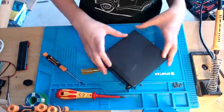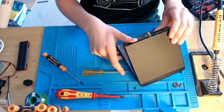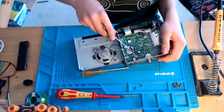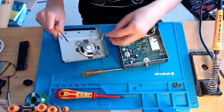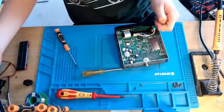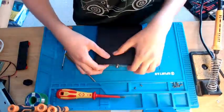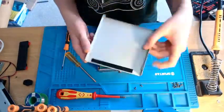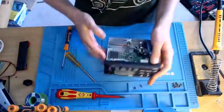The next thing you're going to do — now you've taken out those eight screws on each side — is take the top half and lift it up, revealing the speaker, which will just come off. There is one little connector here attaching the speaker wires, so you're just going to unplug that. The speaker is attached with two screws. It's a fairly loud speaker; when it's running it's not the clearest audio, but it's not too bad. Then take off the bottom half with a little bit of force — that's just identical to the top, just with no speaker in the bottom.